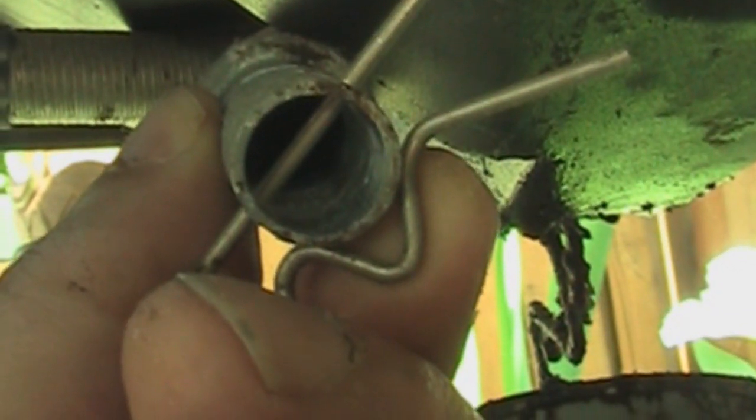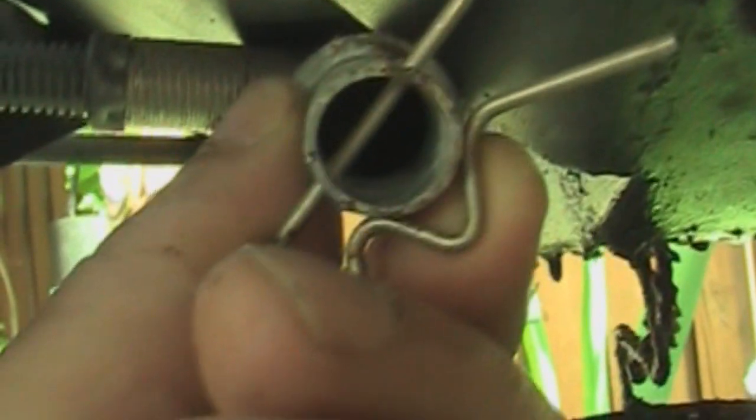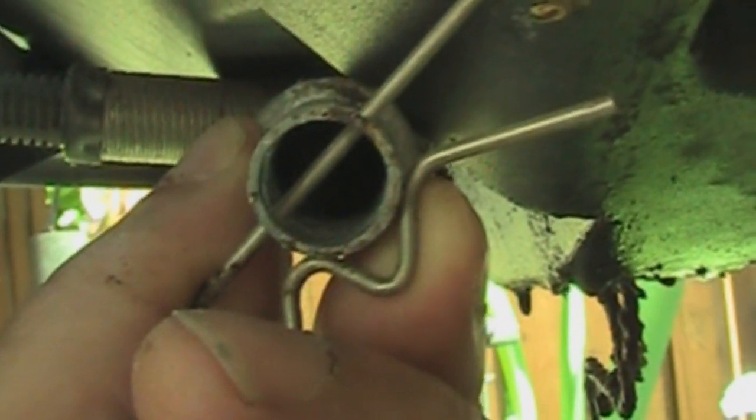Now while you're at it, inspect the inside of these tubes for spider webs. If you got spider webs in there, that's how those knobs catch on fire. Webs are just strong enough to block gas that's going to go up into the burner. And that's what happens. It goes straight to the knobs here because, just like water, it's going to go for the easiest access. But always check these hoses and make sure they don't have webs in them. It'll save you a lot of grief.